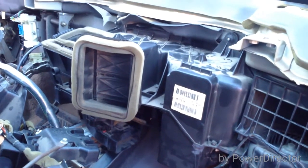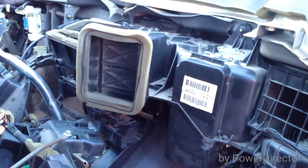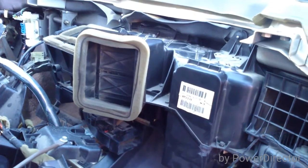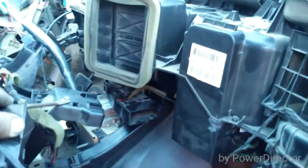This is kind of a tutorial recorded backwards — I didn't know what I was doing taking it apart, so as I put it back together I'm going to show how it was taken apart. If you're going to do this, it's a '98 Dodge Intrepid heater core — quite the chore. This line here just feeds air to the back seats, but the whole heating/cooling unit has to come out in order to get to the heater core. Great design.